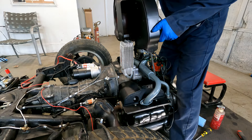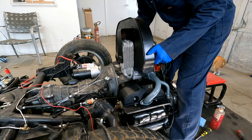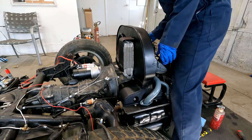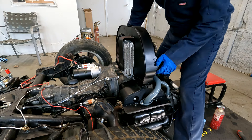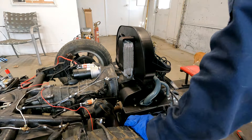With that done, we put the new fan shroud in. You can see the back of the fan shroud has this ductwork — it'll force air through the new oil cooler. The important thing is it keeps that air out of the cylinders. These little screws are often hard to get, so I'm loosening up the engine tin to get the fan shroud in a little better.